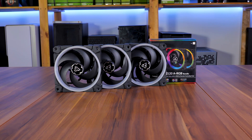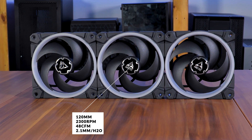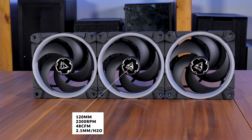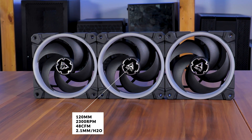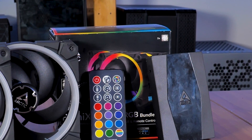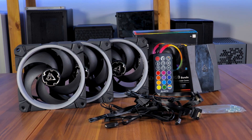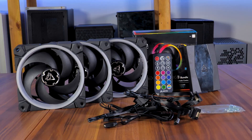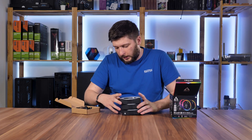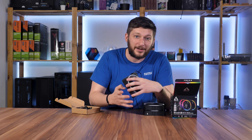Okay, let's go over the specs. Inside the box you will find three Bionix P120A RGB fans. Each is a 120mm fan able to spin at 2300 RPM while pushing 48 CFM at 2.1mm of water. Inside a smaller box you will also find an RGB controller accompanied by an IR remote, a ton of proprietary plugs, and of course the iconic Arctic phone-shaped manual with a QR code.